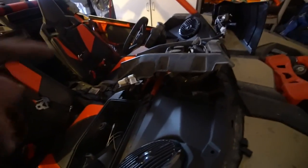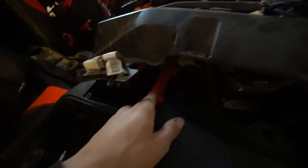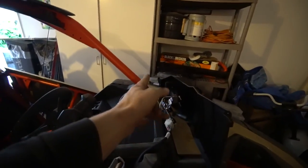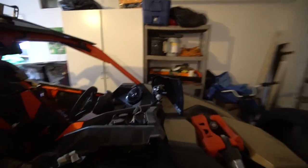Update: that plug actually did connect to the stereo wiring harness. All I had to do was take this little white piece off. It already has some electric grease in there — good for keeping it watertight. These took two seconds on each side to put back in. Now I'm going to have to drill two holes somewhere right in here. There are little divots already — I think that's where the holes go — and then clean up the wiring with some zip ties they provided.